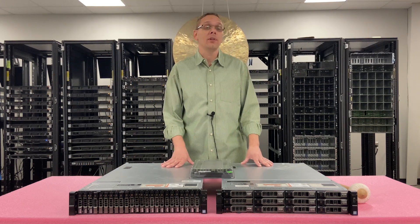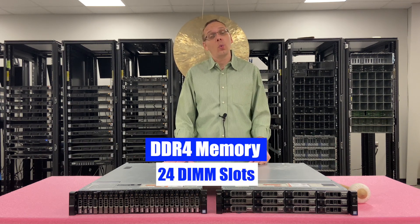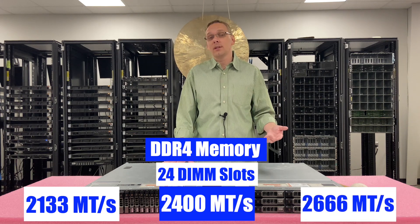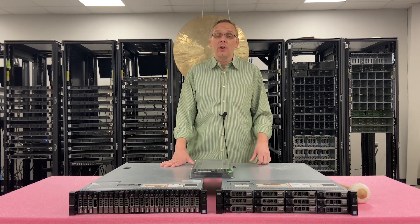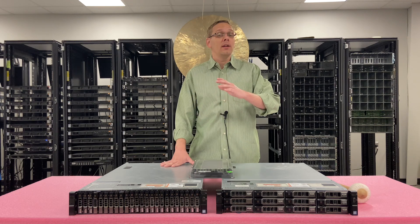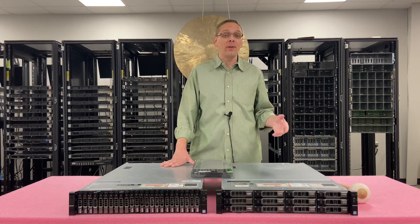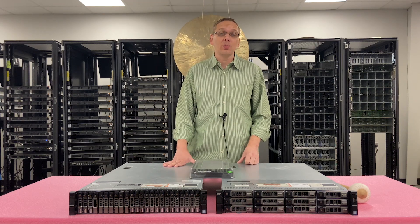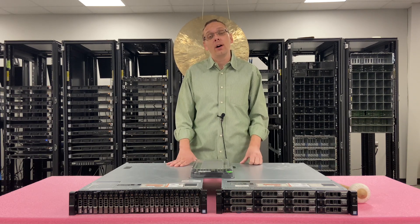This video is going to be specifically focused on memory for the R730XD. It takes DDR4 memory and there are 24 DIMM slots inside. You can use a number of different speeds: 2133, 2400, or up to 2666, and technically you can even use 2933 or 3200 speed. But 2666, 2933, and 3200 will all clock down to 2400, and that's only if you have V4 procs. It'll clock all the way down to 2133 if you have V3 procs. So really there's no advantage to those higher speed modules — 2133 and 2400 is really what you're getting on the speed side for the R730XD.